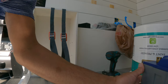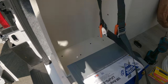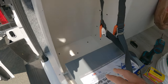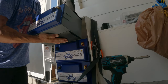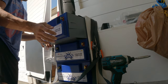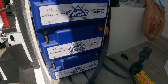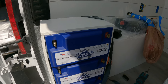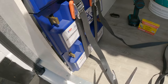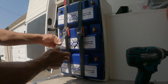Now I can put the batteries in, and I'm going to put them in upside down so that the positive is closest to the equipment. Before I put the batteries in I'm going to cut some of this thin rubber just so the battery doesn't vibrate around and make noise against the wood and the other batteries. It is safe to mount lithium batteries in any orientation because they don't have any liquid inside of them, but if you're using any other type of battery you may not want to mount them this way. Now we can take the straps, tighten these down, cut the excess off, and take a lighter to seal the edge so it doesn't fray.